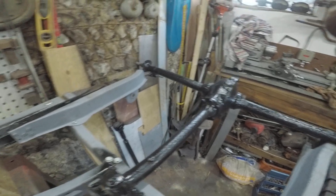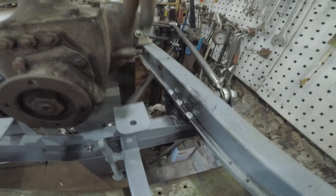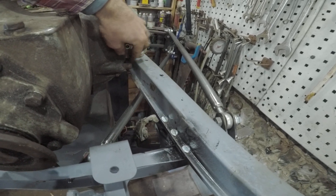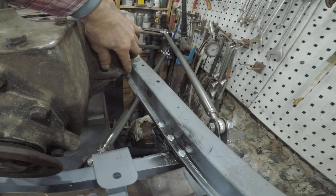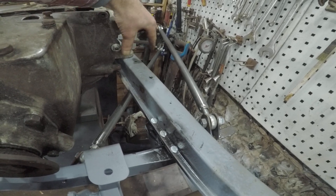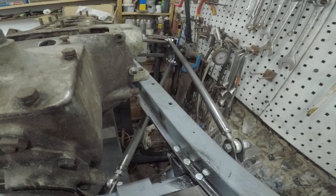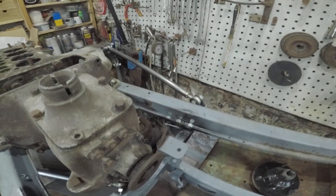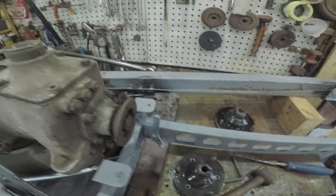The back axle is just roughly mounted on the back here — just to get an idea of dimensions. When it comes to the brakes and the foot pedals, I'll probably still run the clutch off the standard position, with the clutch pedal bolting straight to the output shaft on the side of the bell housing. Then I'll have to make up the brake pedal and the hydraulic system off of that. I'll probably get a standard Morris Minor brake master cylinder and make something up. I've also got to make up a bracket to support the floor in the middle of the transmission tunnel.